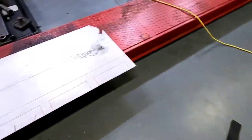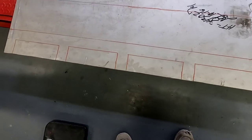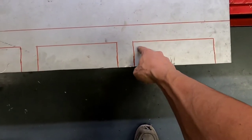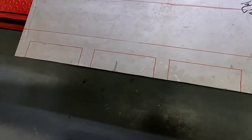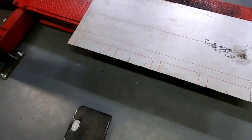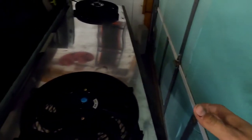This is kind of how my spoiler is gonna work. I'm gonna use this part as a spacer — the holes I'm drilling are gonna be slots made with a hole saw end, then use the grinder to connect them, and that'll be my dropout slot. The spoiler piece sits on top of that so you can't really see the holes in the top of the tailgate. That piece is four feet wide and the tailgate is 61 and a half inches wide, so I've got to add small pieces on each end — might do a little more tilt on those.